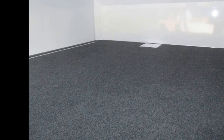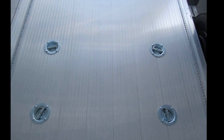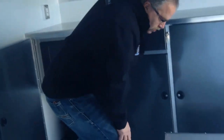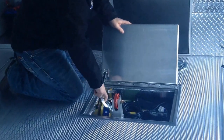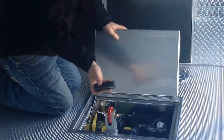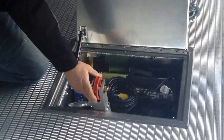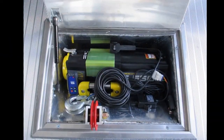The airline track works great for tying down light-duty stuff or lighter vehicles. We also have 6,000-pound swivel D-rings to tie down heavier vehicles. There's a nice 5,500-pound winch with a synthetic rope — all of our ATCs now come with synthetic rope instead of cable. It also has a wireless remote, and the rope comes up and over a roller so it's not dragging on the ground all the way to the back.